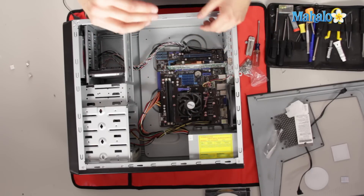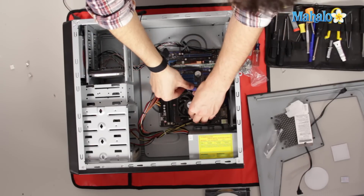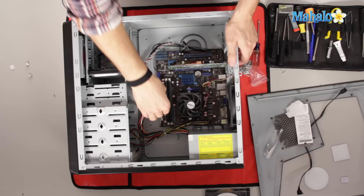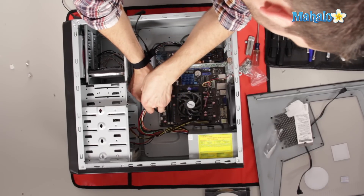Let's take a look at our processor here. More times than not, you'll have two clips on the processor. A clamp will simply hook on one end and then hook on the other end — it's like a tension clamp. You have the safety latch here. Before we dive in and start yanking stuff out, we'll want to remove the power cord from the motherboard. It'll have simply one clip on the side. These can be a little bit of a bugger, so you might want to go back and forth.